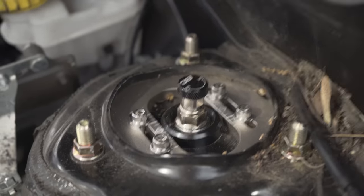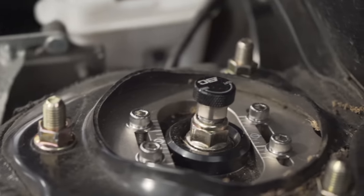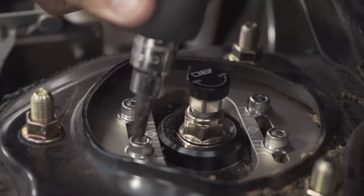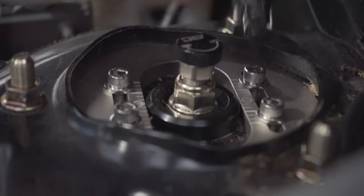The good thing about these BC Racing coilovers is you can just adjust the camber right there because they come with camber plates. I've never done this ever, so Senpai is going to take the lead. Hopefully we just have to adjust those four bolts with the Allen keys and we'll get some camber on this piece. Right now they're in the middle of the hash marks — we're going to loosen them up and maybe max it out.